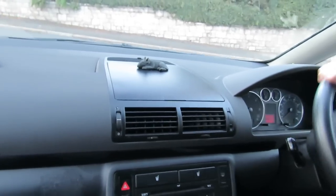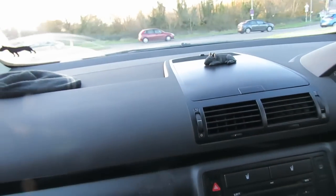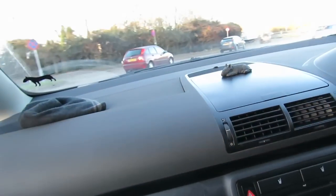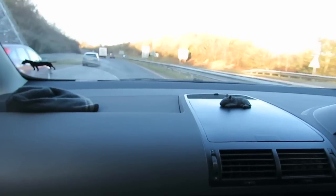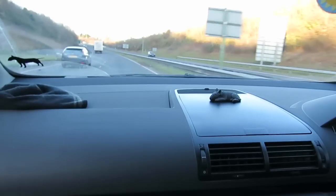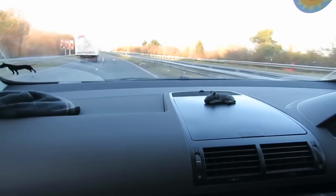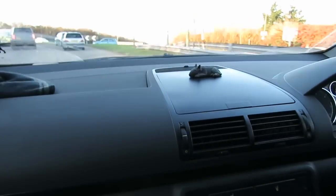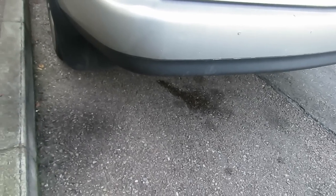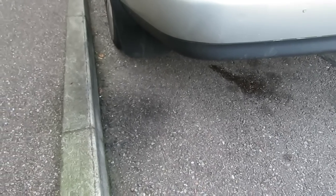Just taking the Sharan 1.9 for a test drive after giving it the water and detergent treatment. The car seems more positive, more responsive. As yet, it's not gone into limp mode. After driving the vehicle for about 600 miles, including motorway driving, whilst the intermittent limp mode didn't actually stop, when I got back and put my foot down going up a hill, a huge plume of black smoke came out of the exhaust. It was staggering — I couldn't even see the vehicles behind it.